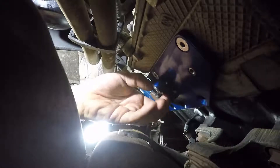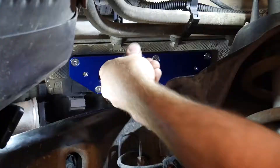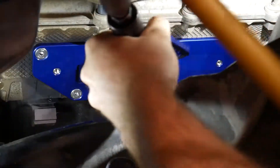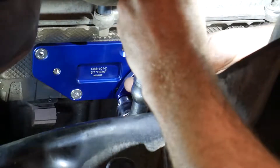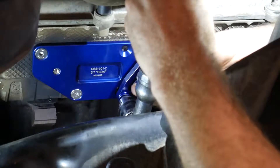I had to take the drill guide off of the template, pre-assemble it on my drill, and then hook it back up into the vehicle. These drill bits are very short — if you don't have any of these very short drill bits, you may want to buy some. If you're ordering a template, they offer the drill bits at the same time. I'm using one of those short drill bits, but I had to cut it down about a half an inch to fit it in here.